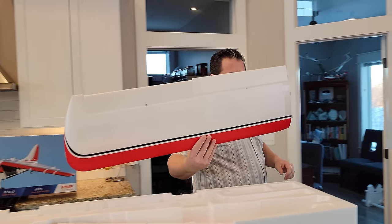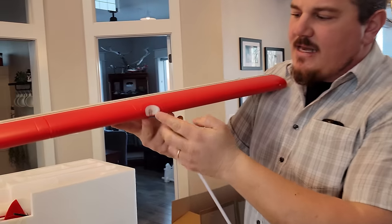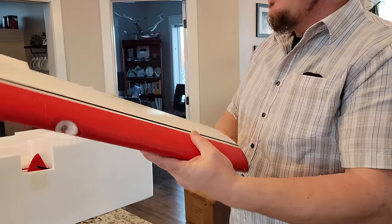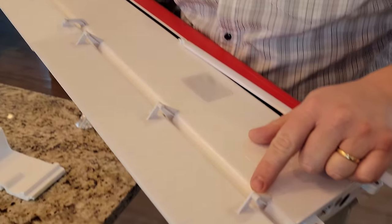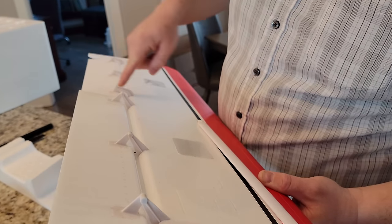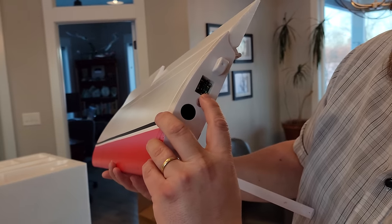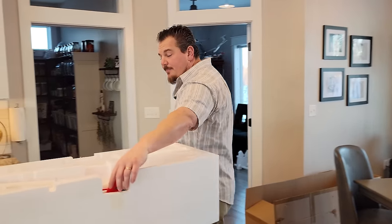Getting into the wings — absolutely gorgeous finish. We've got the wing strut installed. Look how smooth everything is. The LEDs are protected by plastic, there are wing tips for nav lights, and landing lights — one on each wing. There are huge flaps and ailerons which are inset, and you can see they are a Fowler flap — they separate away and the same thing with the aileron, which is very unusual. It has a Fowler hinge that pivots back rather than on the leading edge.